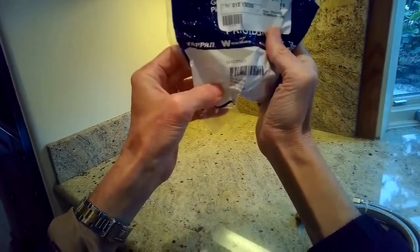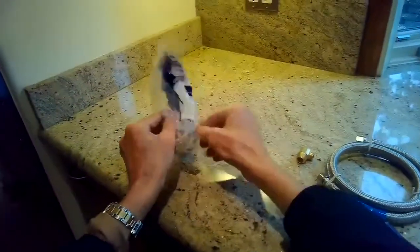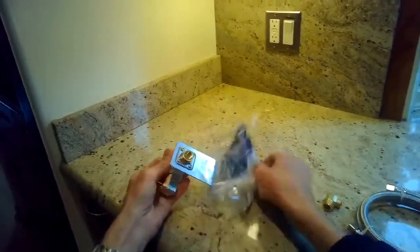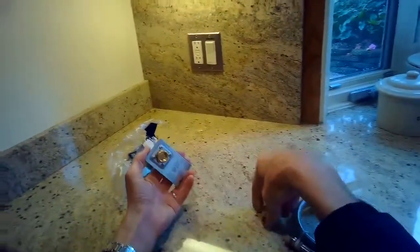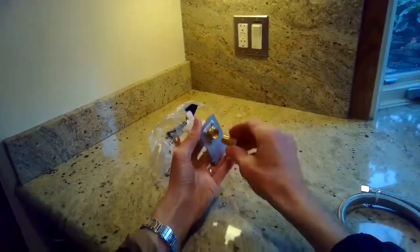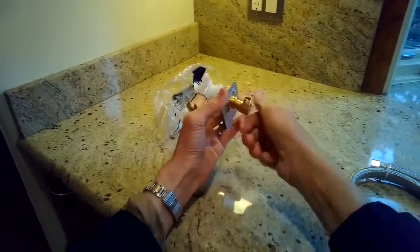To cure it we have to put in a new fill valve. Here's what they look like — these are about $40 and you can get them on Amazon, a generic type of fill valve. We also need a little brass elbow that fits in there to help it connect back to the water supply from the house. The Miele fill valves just kind of stick after a while.